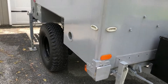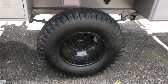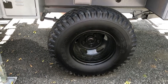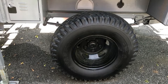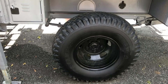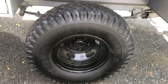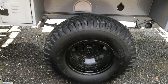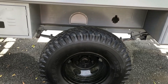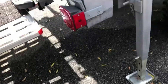These wheels have been reversed — normally you'd install them the other direction on an M-101, but to get a slightly wider wheel stance they've been flipped outward. It's a military-size 16-inch rim with a 9-inch sidewall, coming out to about a 34-inch tall tire sitting on leaf springs.